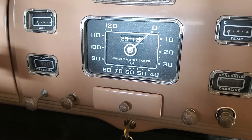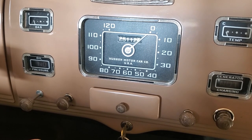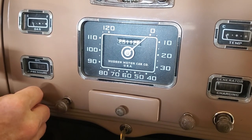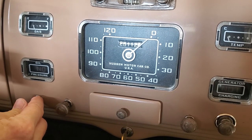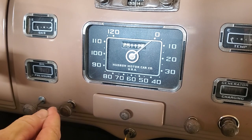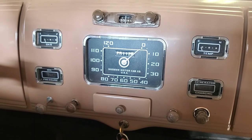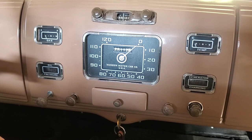It'll be totally dependent on the temperature, and that's one of the things you learn about antique automobiles: you're having to do the things that are now done by a computer in your modern vehicle, which sets everything up properly. Well, you're doing all that by hand, so you kind of have to have an idea. And you notice I'm using up to about this point on my finger here to set the choke. That should be pretty good for the temperature we've got today, because we're about 90 degrees range. So this should be pretty good for an actual start.